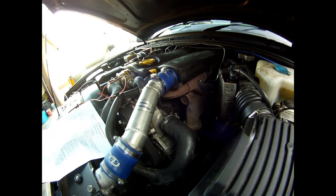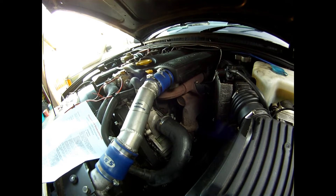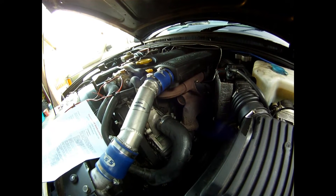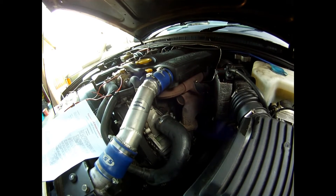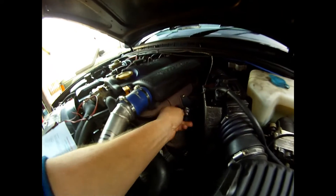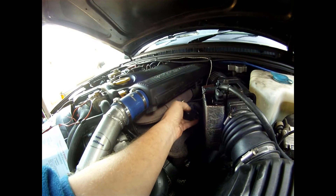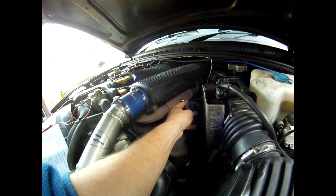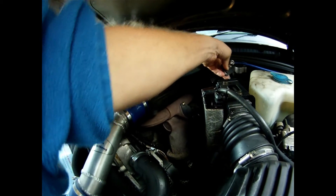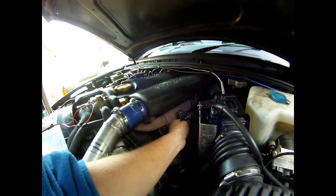I'll note that there are some excellent technical publications that Ian produces on the diesel unit. He talks about turbochargers and the difference between compression ignition engines and petrol engines. This is the unit that fits onto here — he's purposely designed it. It comes with a gasket, a straight swap over, and it also has the housing for the temperature probe unit, which fits into the exhaust manifold.